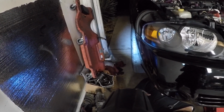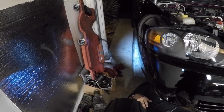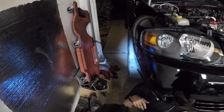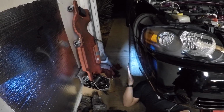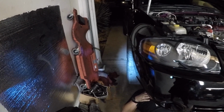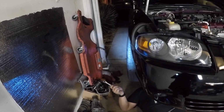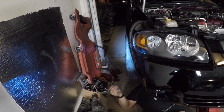Yeah, I think this rack is just really off-centered, or there's a variance from OEM tie rods to the ones from ProForge that make the chromoly ones. Why, you maxed out? Well, this side was maxed out before I started. And that side is maxed out to bring it to 0 toe. So basically I brought the maxed out 0 toe on this side to that side. That doesn't make any sense. Do you have more adjustment on this side? Oh yeah. I'm able to bring it out, bringing it out's not the hard part, but say if I wanted to toe it out more, I couldn't. Even though there's more threads, it was bottomed out. The inner was hitting the inside of the heim joint.